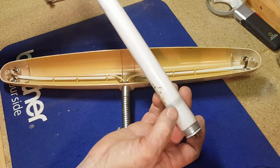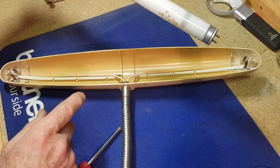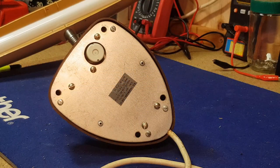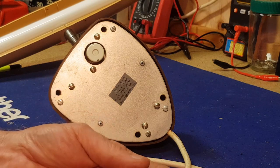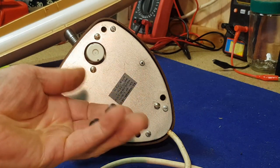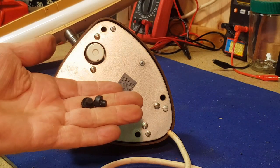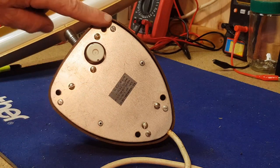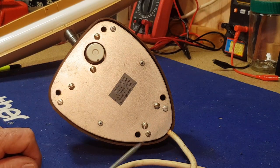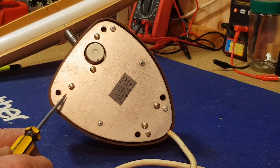The tube's very, very dirty — I'm not sure if it's okay. Maybe I should round up another tube and see if that works, which will prove that the ballast transformer in the base is actually okay. Now I've removed the rubber feet — they're just a push-in type and they've gone quite hard. One was missing. So I've got the diameter hole measured and I'll take these back to the shop and try to find something out of the e-waste. We do need to remove four screws — they're a flathead screw, which makes me think this light is probably more 1960s than 70s.